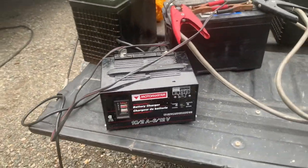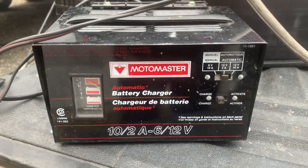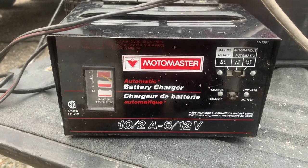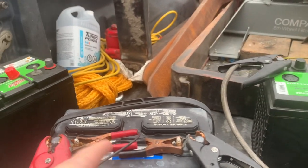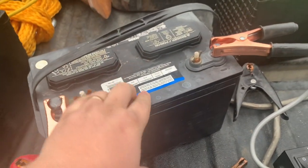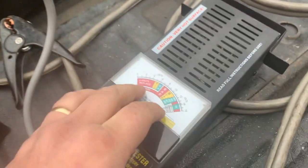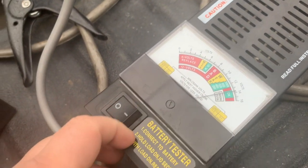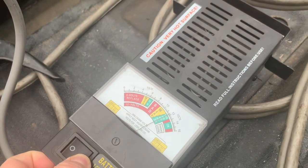It's the next day, about 5:30 in the afternoon — March 10th, Sunday. It looks like it's fully charged now. Let's put a tester on it and see what we got. The decent battery — this isn't brand new, it's from the 4th of 2022 — is reading good at almost 14 volts. Let's put a load on it. Yeah, it's still in the good territory. So let's try the revived one now.